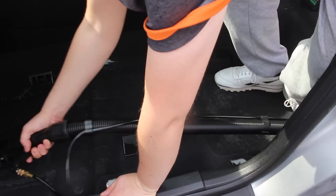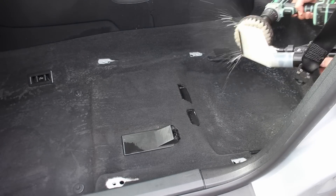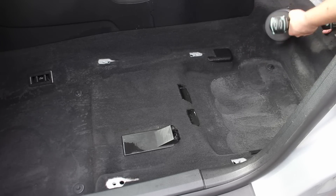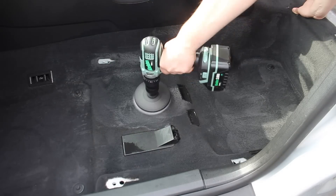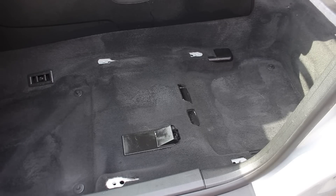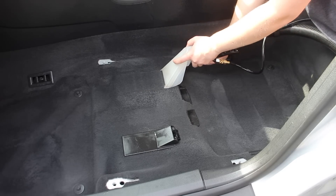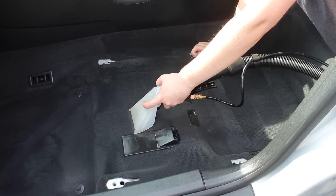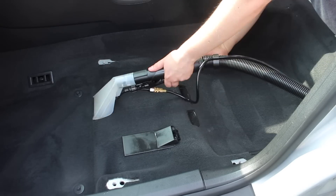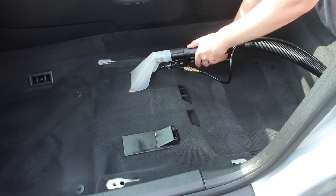I started off by saturating the carpet with some carpet shampoo — the one I used was Pro Clean Carpet Shampoo and I will leave a link in the description below. It's actually quite cheap and quite effective. I then agitated this with my Chemical Guys soft bristle brush on the end of my Kielder drill, which allowed any dirt to be loosened up and made it a lot easier to extract using the extraction function on my Henry Wash. Then it was a case of going over the carpet a couple of times until all the water was coming up nice and clean. On the first pass it was still brown, but by the second pass the carpet was actually pretty clean and almost looking like new.